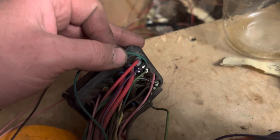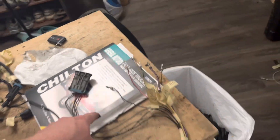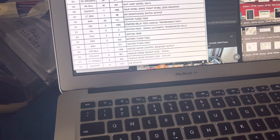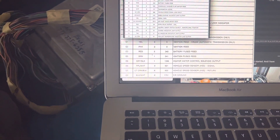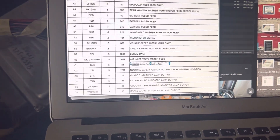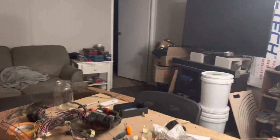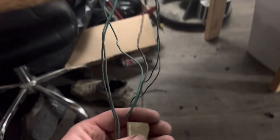I spent hours trying to find the C100 pinout. I even bought the Chilton book — it doesn't have it in there. The schematics in that book are wrong for how this works, so it's absolutely worthless. I did find it online eventually. The function listed is "air inlet valve motor feed." I'm not entirely sure what it does exactly, but it probably moves some door to recirculate your air or something. It's okay to leave it connected, so I'm going to leave it on.